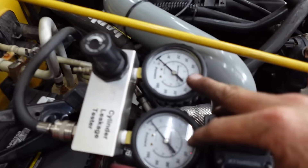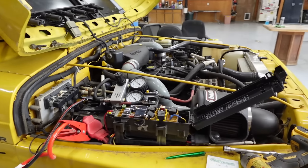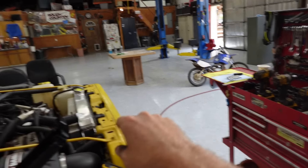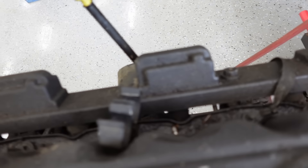I've got a leak down tester — I'm gonna see if I can make it leak out of the valve. This coil pack — I can't tell you how many times I've fixed Jeeps that had brand new parts thrown at them and it's just cheap made-in-China junk that's all you can buy. Let me get this leak down set up, see if we can make it leak. If not, we're gonna throw maybe some new plugs so we can read off of them. I've got a junk motor up there with a busted piston, so I'm gonna get this old factory coil pack off there that I know is good and see what it does.